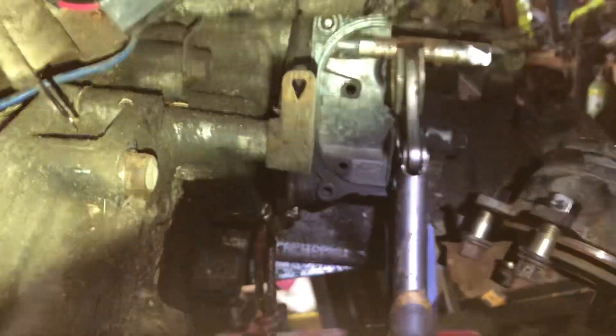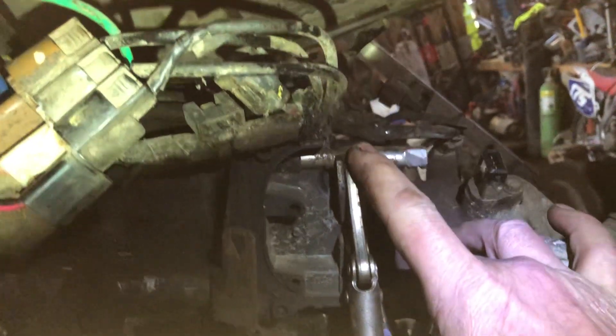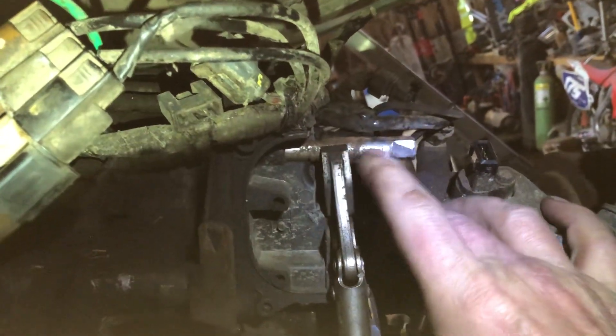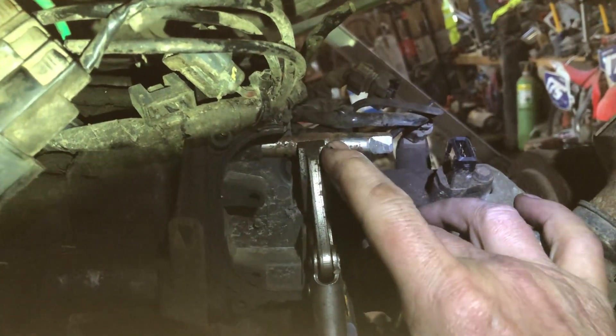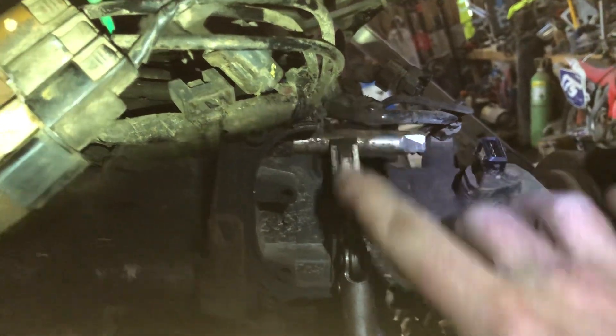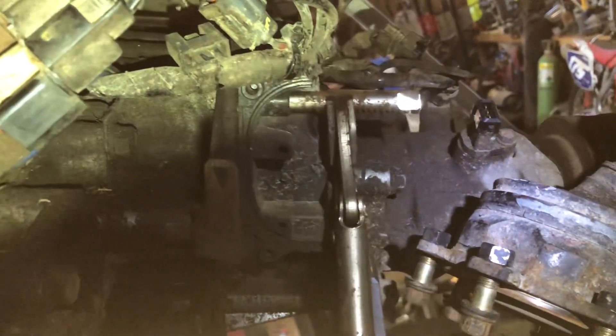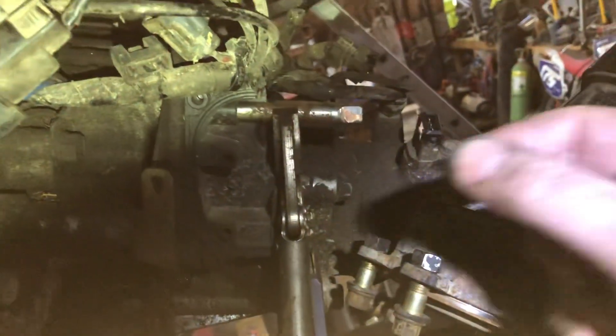What this is — I don't think I've showed you this before. See this thing here? That is a four-wheel drive unit and it's activated electrically. Now the electrics on this four-wheel drive unit have not been working very well. So what I'm doing here is I'm drilling a hole through here — I've cut off the plastic — so this will be pulled in and out with a lever from now on.